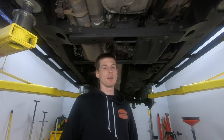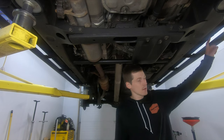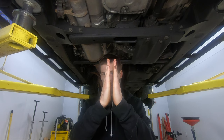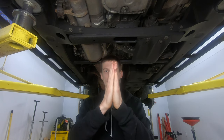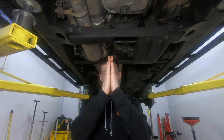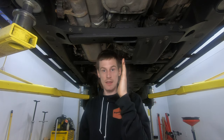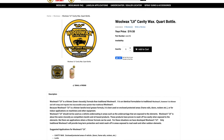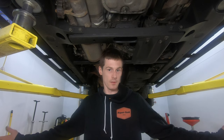The downside is the thickness of the product. Wool wax is so thick that if you spray it inside a rocker panel or inside the frame, it will not penetrate the pinch welds. Instead of getting in between the two pieces of metal, it'll just sit on top of them and you'll have rust form between the pinch welds because the product is so thick it won't go down into the seams. And if you think I'm wrong — wool wax actually went to the time and effort to develop a low-viscosity version of their product. Why would the company develop an LV version if what I'm saying isn't true? They wouldn't.